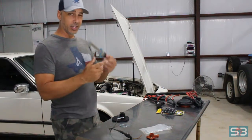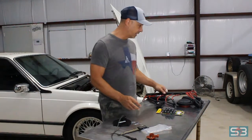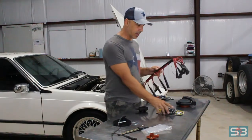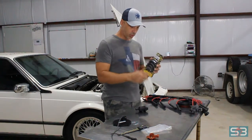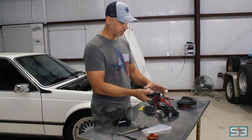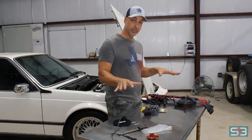There's not many instructions, so what I'm going to do is measure the front clearance — once I bolt the spinning part on — between it and the sensor, to make sure there's no interference before I actually start the engine. For the spark plug cables, I want to get these converted over to the LS coil packs. They're obviously too long but about a year old, so I'd like to still use them. I picked up Taylor Cable part number 46069 from Summit Racing — these adapt what I have to the LS coil pack connector. I'll cut these down and put the adapters on. Interestingly, they actually snap right into the coil packs, but they're still too long, so I'll shorten them down to use the specific ones for the LS coil packs.